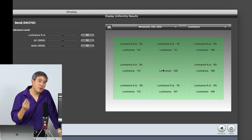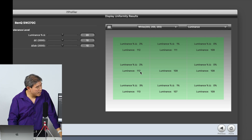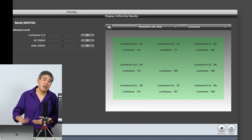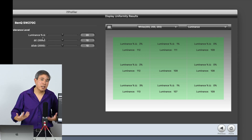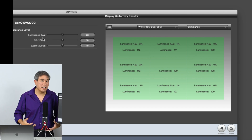If we set our white point to about 100 candela and we're measuring at 100 candela — if it's off by one or two points, that's not a big deal. But when we're talking about dark grays, you'll see that becomes more significant.